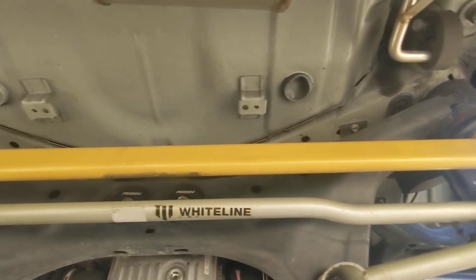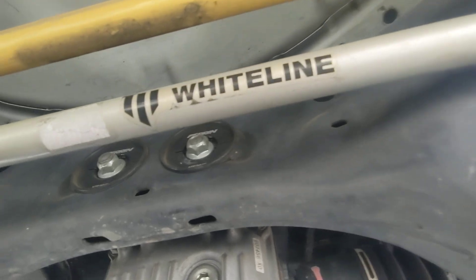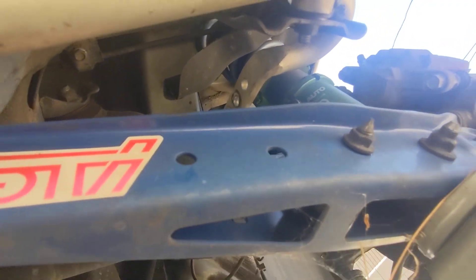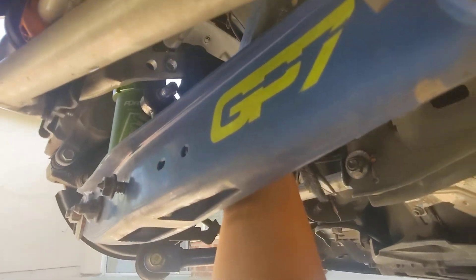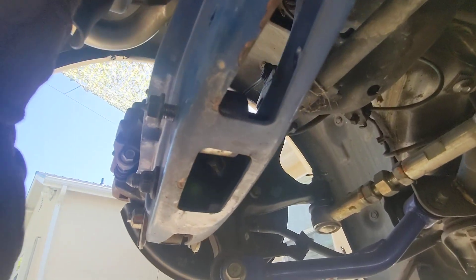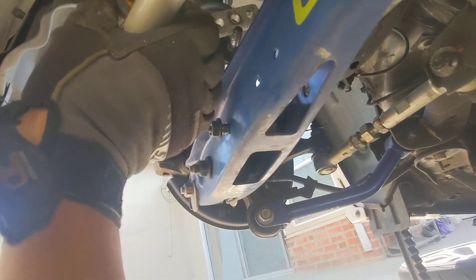From the factory, if you have sway bars, they're usually bolted down pretty tight with these nuts or bolts. What happens is when you move the sway bar up and down, I can barely tell but I'm moving it here — I can just use my finger to push it up and down. Sometimes these brackets will pinch the C-cup bushing that goes on, and if it pinches it too hard, this sway bar is not going to move very easily. What I actually had to do was add a small washer here just to space it off a hair so that the bracket wasn't pinching the sway bar in the bushing.